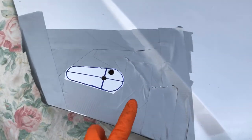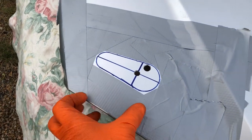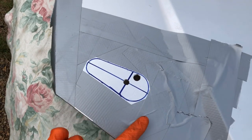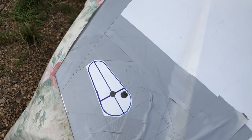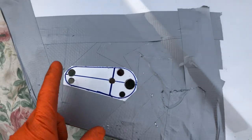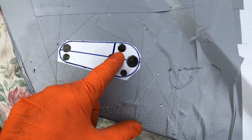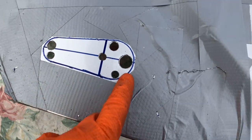I've also gaffer-taped the bonnet. The reason for this is it's a metal blade and a metal bottom to the jigsaw - if you don't do this it's going to scratch all your paint up and you'll end up with a load of damage that looks really untidy. There are the extra holes on the bends, which just makes it easier to join them up. Whenever I cut these I cut them with a step cutter so you can keep going down until you get right to the edge of the line - never go past the line though.